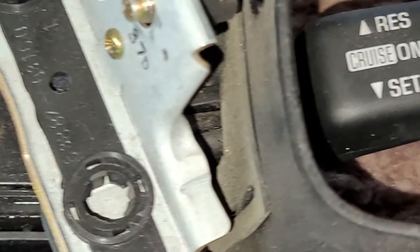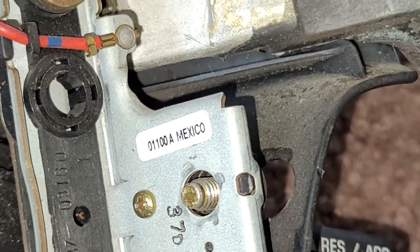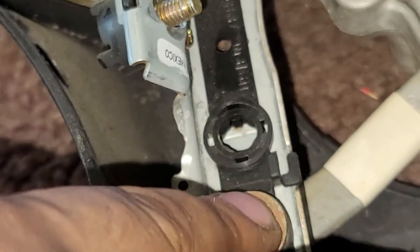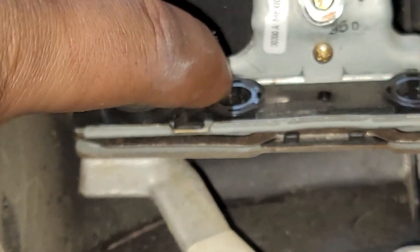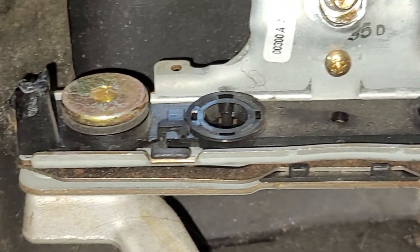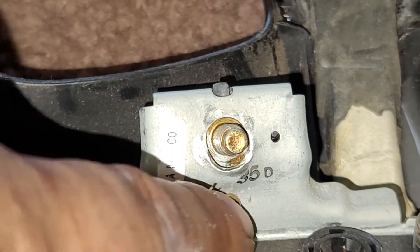So as you can see on this side, it is all — oh, you're telling me it was made in Mexico? Anyways, this bracket is straight as it should be. Meanwhile, this bracket got bent. You could easily swap out the brackets. I'm almost curious if you could put a Camry bracket in instead of another 4Runner bracket, because Camry and ES300 brackets use springs instead of this setup here. But yep, the bracket is bent, as you can see.